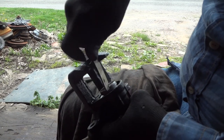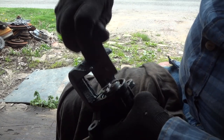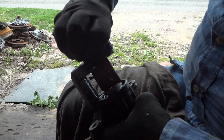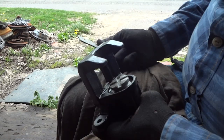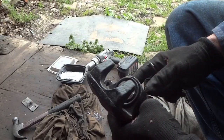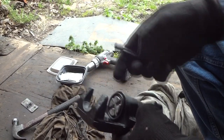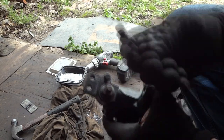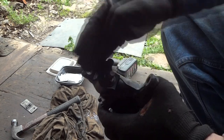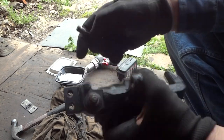When you take your brake pads off, get something like this flat piece and screw this all the way back in, put your new pads on, then pump your pedal up and that will take care of it. There we go - all the way back as far as it'll go. A little bit more - still going, still going. There we go - wow this thing goes way in. Got our seal pushed back in there. I did snap this bolt off earlier but I got it out - that's actually the release handle that screws in there.